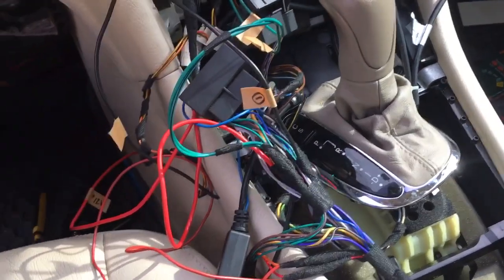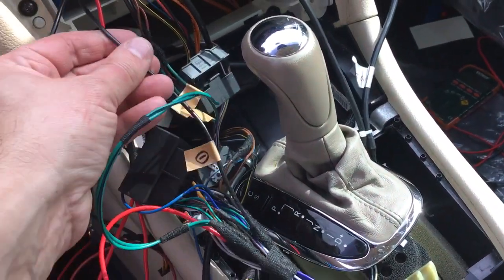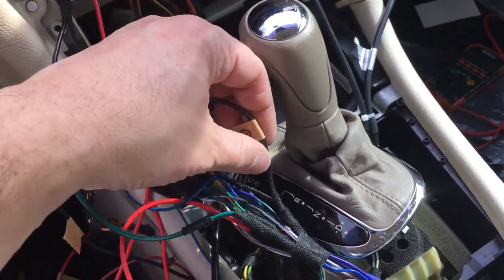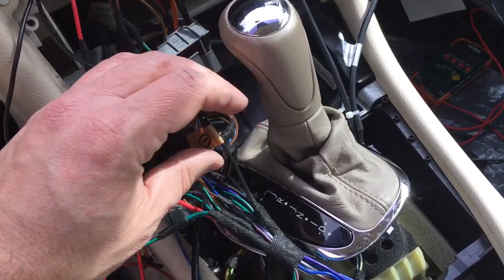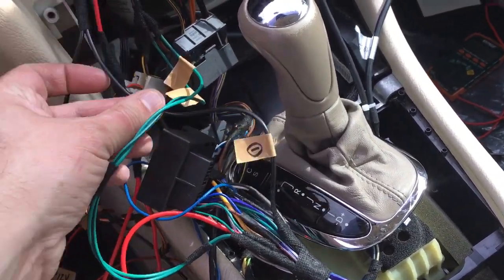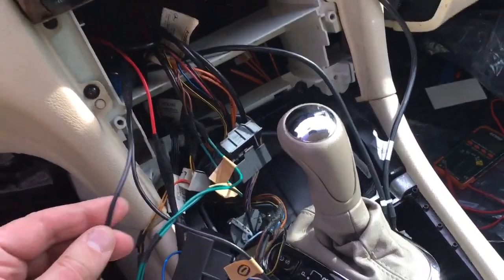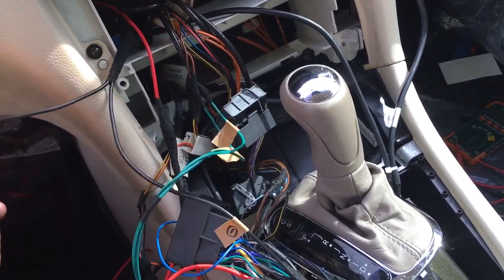Because I don't know what color wires you're going to be using. Ground is the black wire on the harness. So I used black wire. I tried to be consistent. I didn't have yellow wire, so I used red wire for the hot wire, which kind of made sense to me. The ground wire, you just need this to go to the grounding point. And again, don't be confused by this Y split here. This is just because, again, I plan to connect something else in the future.